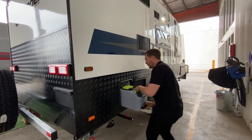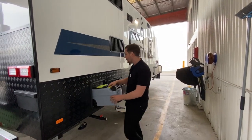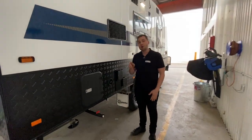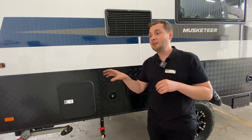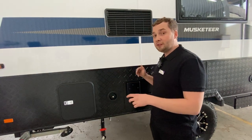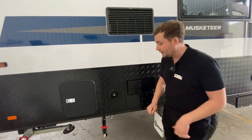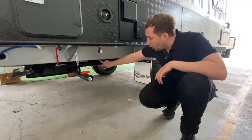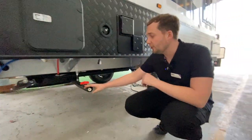We've got our toilet just here — serviceability-wise, it's just out there. It's a 19-litre ceramic toilet from Dometic. On this unit, we have two 95-litre water tanks — 190 litres worth of water total, separately fillable and separately usable. With the pump, you can utilise different water tanks and use switch-over valves to control which tank you're drawing from when free camping. We have grey water tanks under here for all that free camping as well.